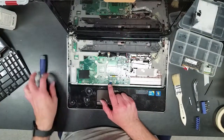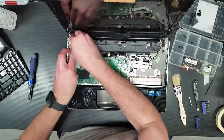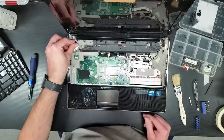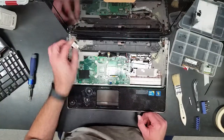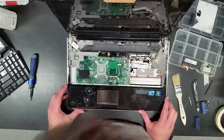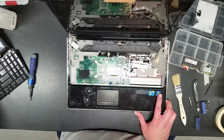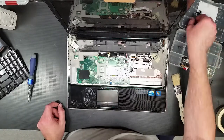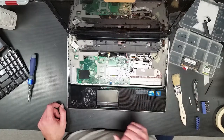That guy hooked up. Hook up the LCD display. You don't want to be tearing this puppy open to hook this thing back up later. All right, snaps into place. Okay, so that looks to be fantastic. Now these guys are going from the bottom. That's the Wi-Fi. That's the hard drive interface. That's from the bottom, memory's from the bottom.